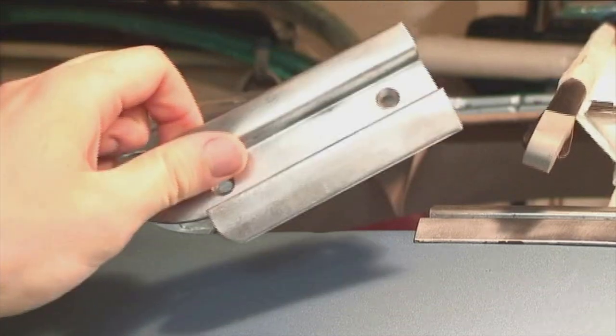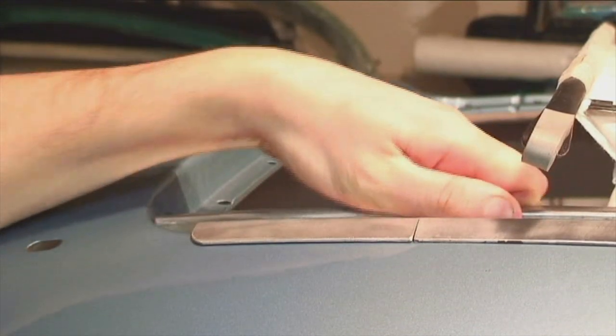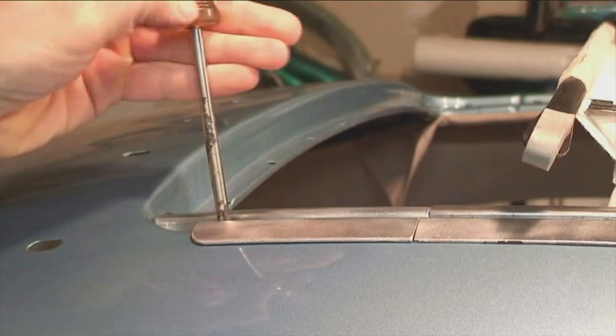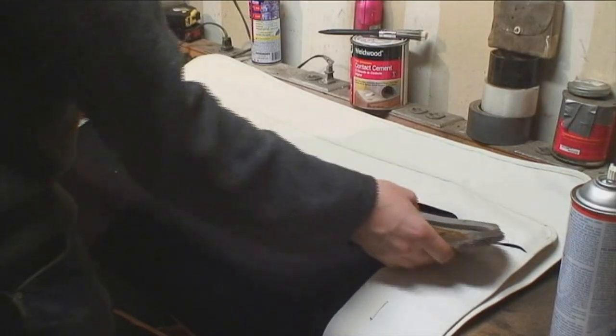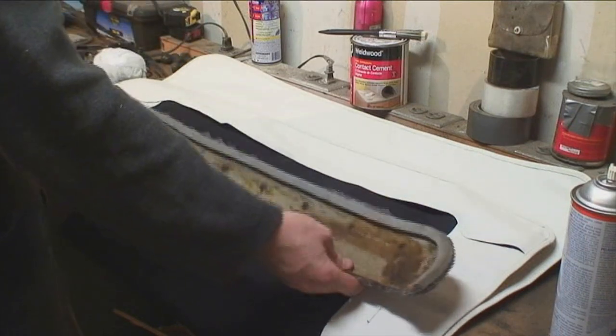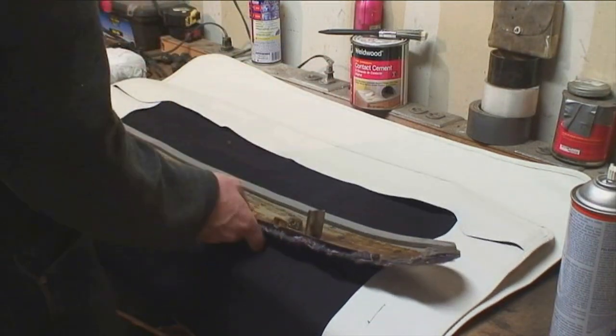Here's where it's crucial — and this is what I mean about where to glue it. As I pull it, it gets even and comes down level with the edge of the headliner. If you had glued it to the sewn lace you would have a huge upward pocket there — a huge gap. Now you can attach the rear rails and tighten them down. Here's the front section of the bow that's going to be going into your ragtop material.